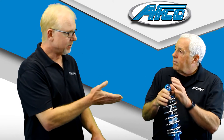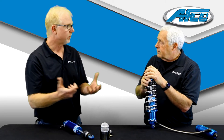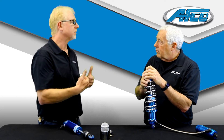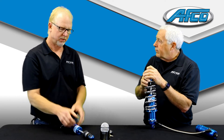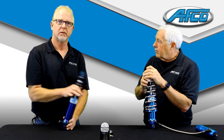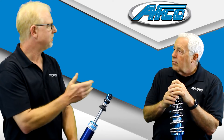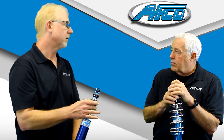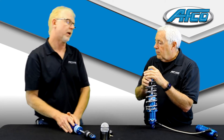You're also going to have to put a little more damping rate into the shock — a few more clicks — because a lot of times we compare our car to somebody else's. If you and I are at the racetrack and we don't take into account that your shocks are straight up and down but mine are leaned over, and I use the same number of clicks you're using, I'm probably going to be underdamped. So that's definitely going to be an effect to take into account.